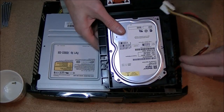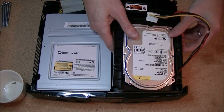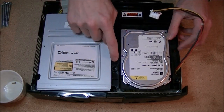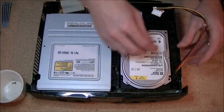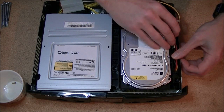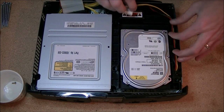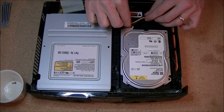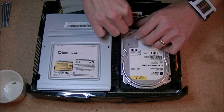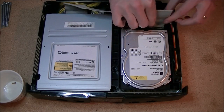Now we need to get the power cable back inside the hard drive tray — there we go. It sits right back down just like the CD tray. Feed the power cable back into its little clips to help hide it, go ahead and put the power back in, and reconnect the IDE cable.